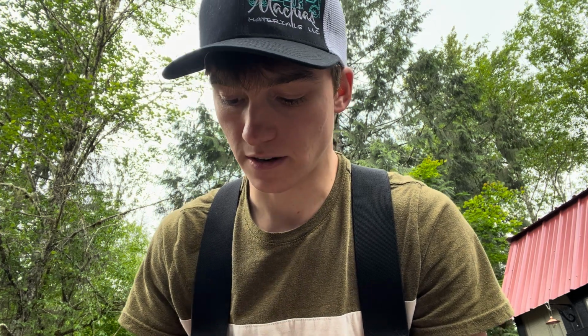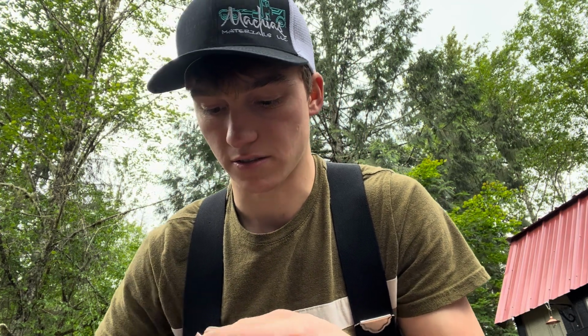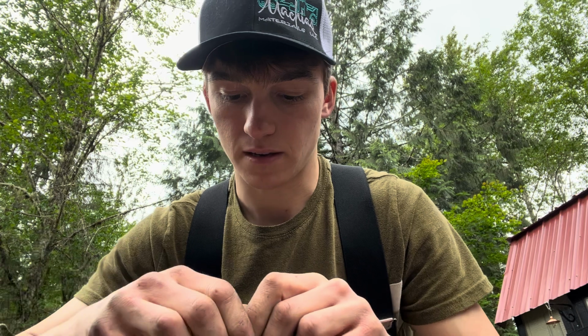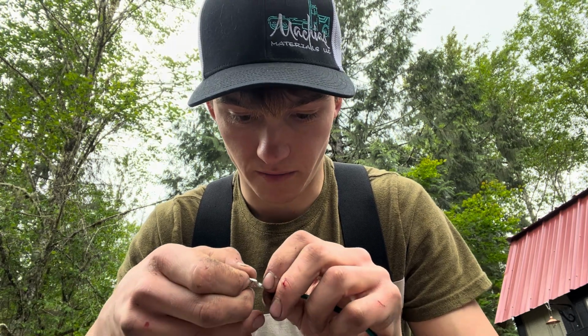You just want it to be in the crimping zone. You don't really want any wire sticking out. There's no reason for it. So I guess strip it like 1/4 inch instead of 3/8 like I was talking. Okay, straighten that out. Get this guy fit on here.